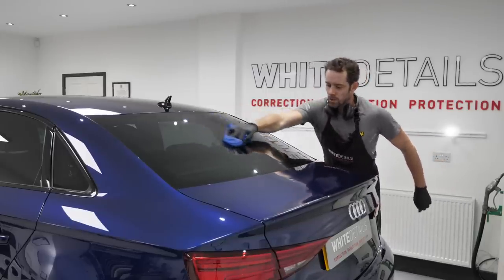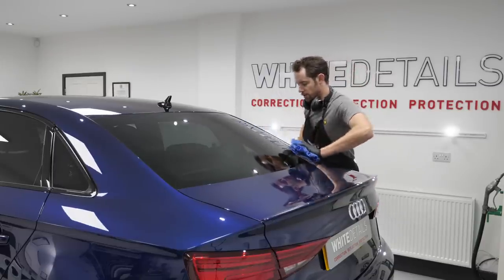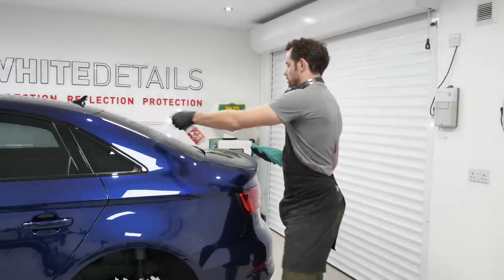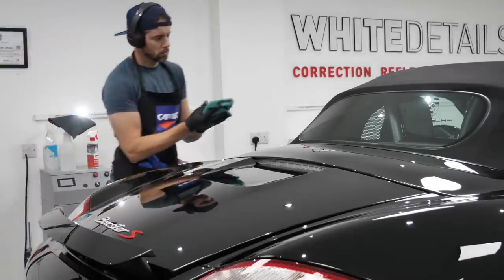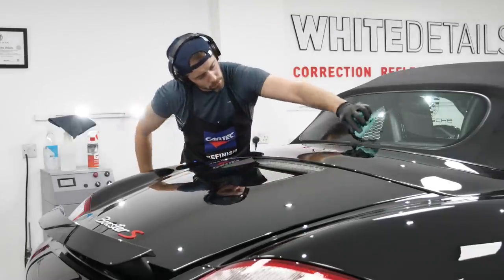I've had fantastic results with the water spot remover, and I just wanted to reach out and speak to Mr. and Mrs. Geon before putting this video together to get their view and their word. There was basically one or two issues with the product on much older glass systems where it had been left to dry. To date, never had a problem. And the trick is, once you've used the water spot remover, to follow up immediately with something like a degreaser or an IPA Geon Prep to wipe away the water spot residues before they dry. And of course, you go on then to use your standard glass cleaner as well.